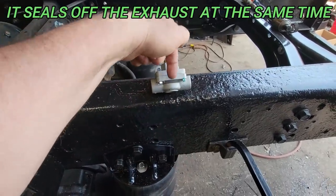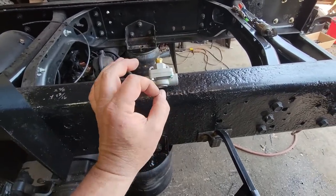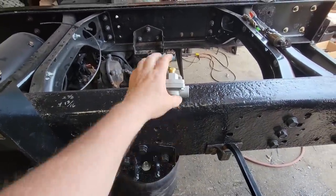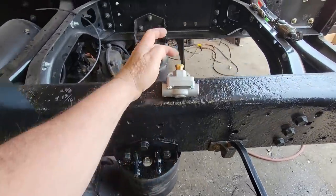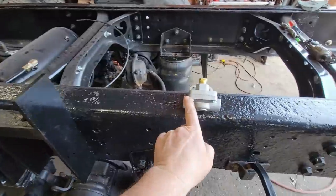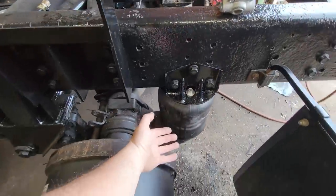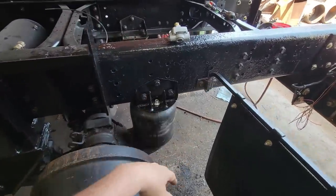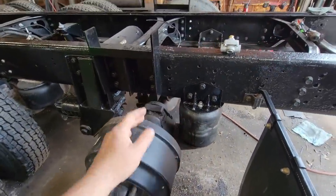As long as there's pressure in this valve, it will sustain that same pressure, because we have a regulator up there, not a ride height valve. So it's going to keep the same pressure in these bags continuously. So this supply size really isn't a problem. The real advantage to this is when we want to lift the lift axle, we want it to raise, you remove air from here. Now it just has to exhaust that quarter inch line up to there. It doesn't have to exhaust all this. What it does is lift that off the exhaust and open the two bags to the exhaust. And then all the air pressure will come out of there. As the coil spring inside here is pushing up on it, it will exhaust all of it through the bottom of the bag. So that should make raising this axle much faster than the way it was on the other truck.